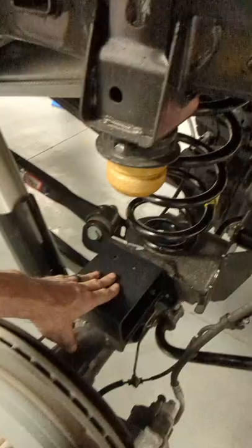With this kit, it was just new shocks, new springs, new sway bar, new adjustable track bar, new lower control arms that are just a little bit longer. No brake line or ABS line relocation brackets, which, I was able to bend the factory bracket a little bit because I didn't like how tight they were. New rear sway bar links, new rear shocks, new rear springs, bump stop risers. I'm gonna drop it down after I get these done, and we'll see how it looks.